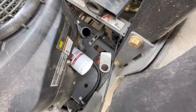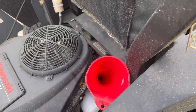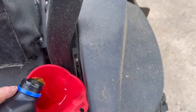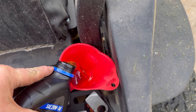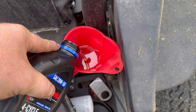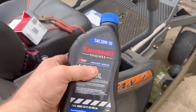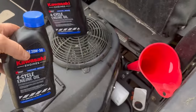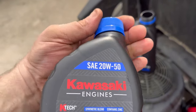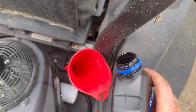I'm going to start off with two full quarts of Kawasaki four-cycle engine oil — it'll probably hold a little more than that, but we'll pour two in, crank it, and then check it. I can hear the keyboard commandos now: 'More Medic, you're using the wrong weight oil, you're gonna blow it up!' Bullcrap — this is exactly the weight they recommend, especially here in Texas when it gets 110-115 degrees outside. It's not even summertime yet and it's 92 degrees today. Quart number two going in.